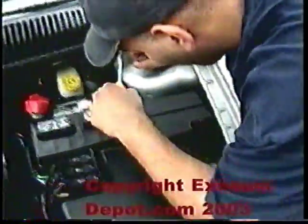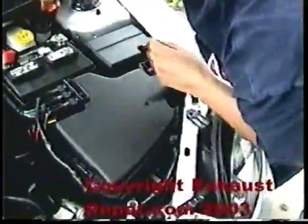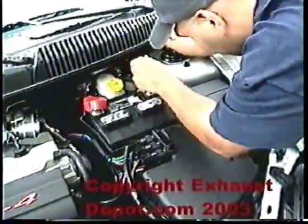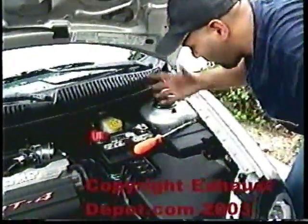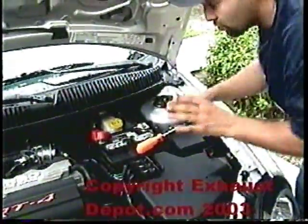So what I have to do is take the big screwdriver, put it on the actual grommet, and push the grommet into the car. Now you can actually see some light from inside the car. We're going to go to the back of that grommet with a blade and cut the side of it — careful not to damage any wires. Then you run all your wire through that grommet, pull it out some, run it through the firewall, then put the grommet back in. That's the hardest part of doing all these boost controller installs.